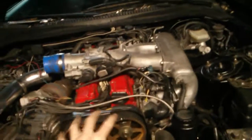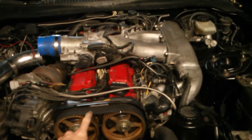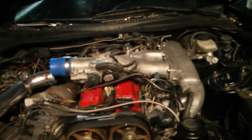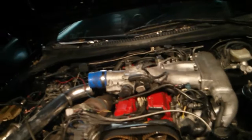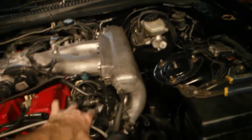The head differences between the NA Supra and the turbo Supra are minimal — valve clearance and that kind of thing appears to be the same. But the camshaft could be different. In my own car I'm using a non-turbo head with turbo internals — beefier valve springs and so on. There's still a difference in how the fuel rail mounts up, but that's my car, not this one.